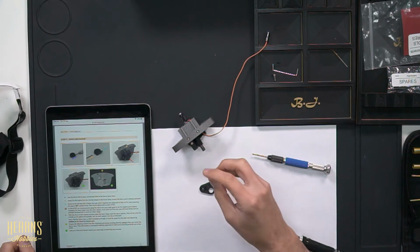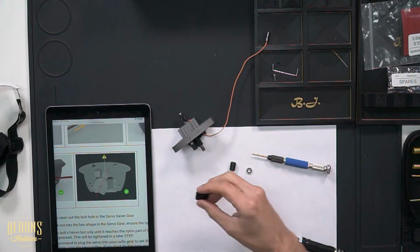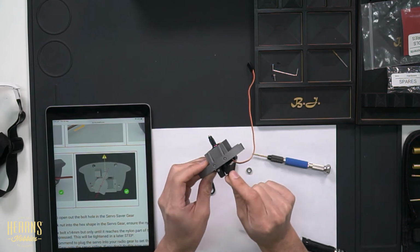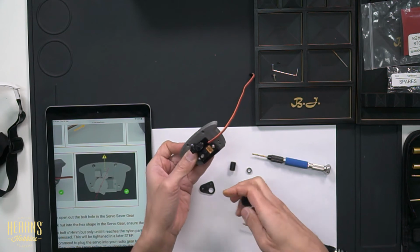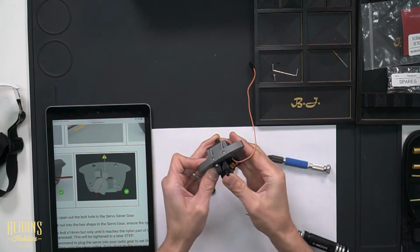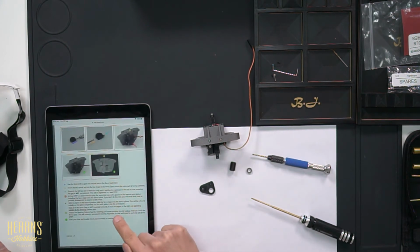Okay, so this is going to have to slide across, paying attention to this particular section here. This part is actually geared and it needs to be perpendicular to here to work correctly. So let's just fit this on here. All right, looks pretty good. Press it in place. Pretty happy with that. So we've got it on. Note that it's not moved vertically. We've got that angled in. Ensure the steering column has a retaining grub screw pointing directly vertical, and we have that when you mesh it all up. Take your time. We've done that, and that's all good.